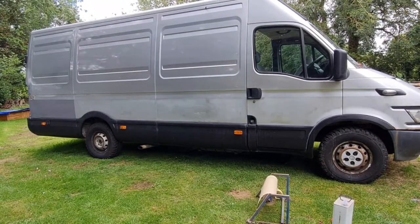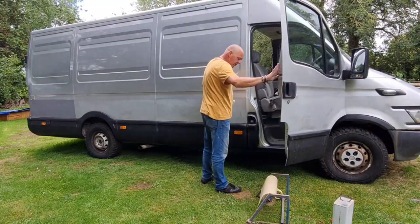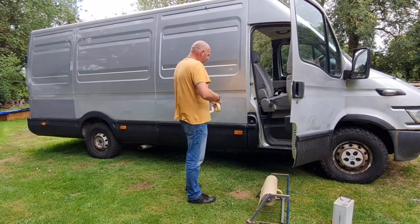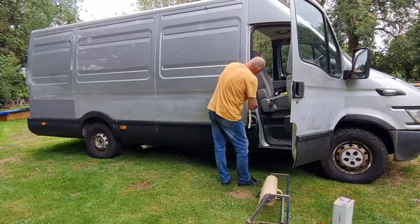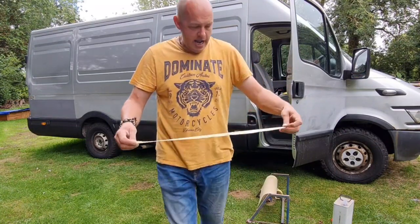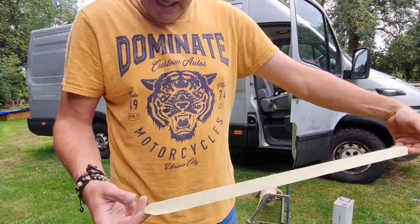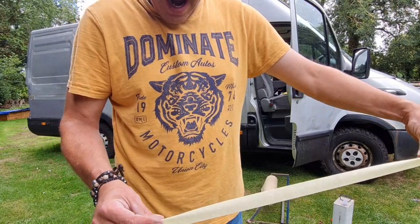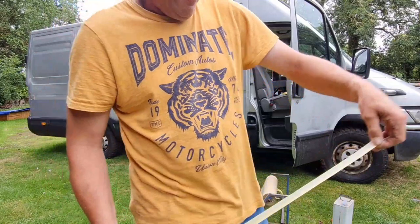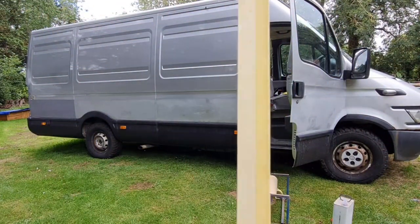Alright, here we go with our 1-inch tape. We want to do a little mask inside the door shut before we shut the door. I'll show you a little trick. Here's your masking tape, right? Stick at the end of your fingers, bend the two ends over, pull it tight, then rub it on your leg. And there you have a back mask.